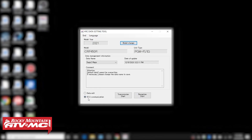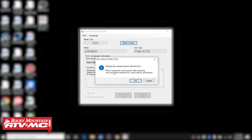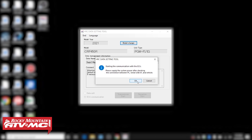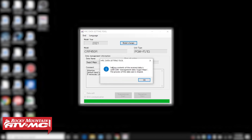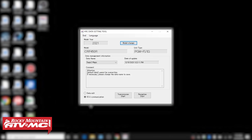To make sure that map was sent over to the ECU, we're gonna hit ECU Communication and hit Reception Start. Make sure the power supply is off, hit okay, and it's gonna start communication with the ECU. Turn this on, hit okay. Then it says the setting contents of the received data is the same as the management data — Sugar 2 Maps. So we know those maps are on the ECU and we did everything right. Turn the power button off and click okay.